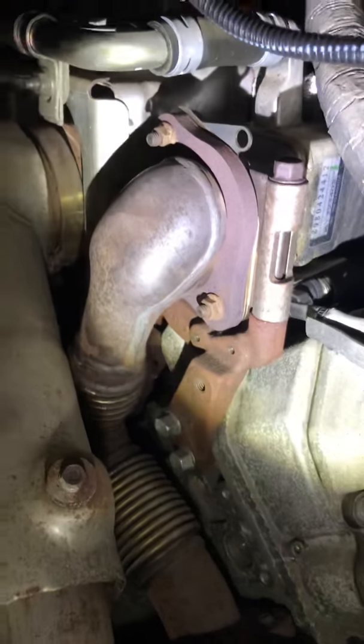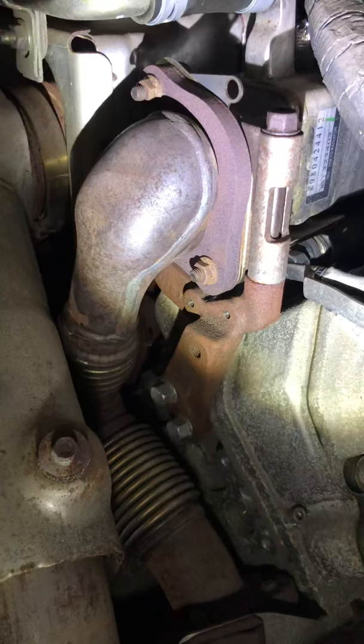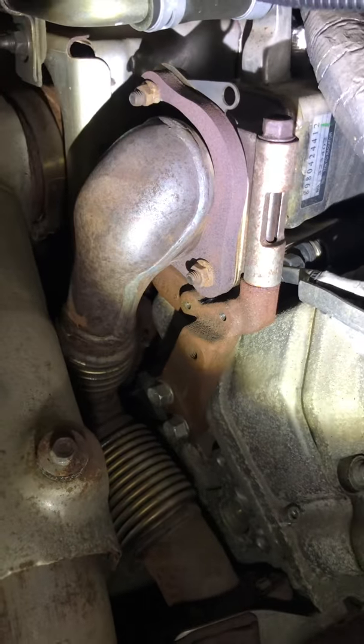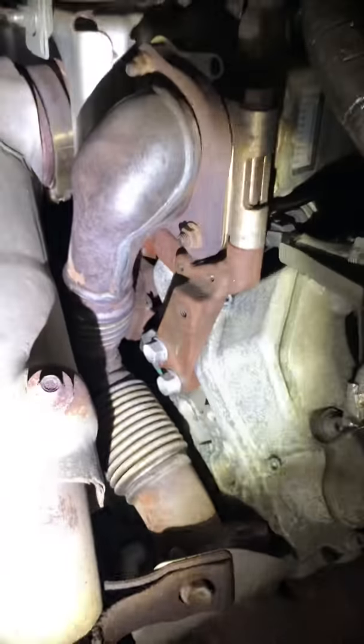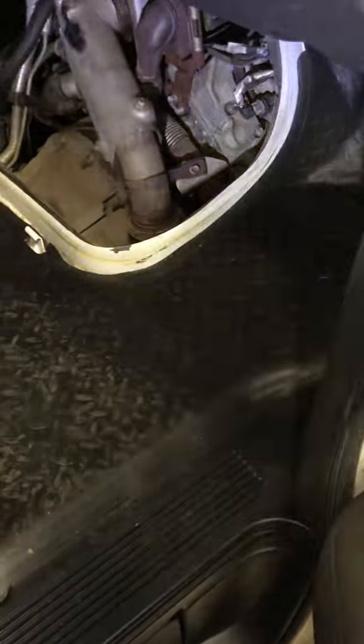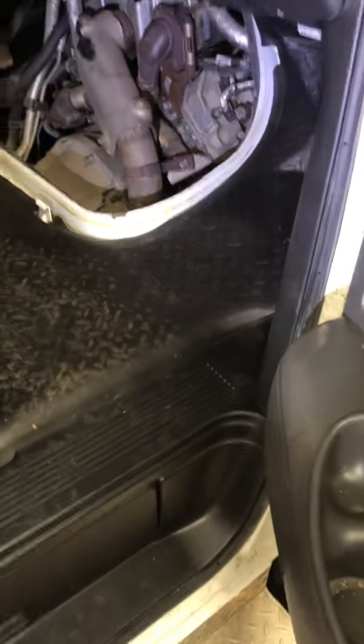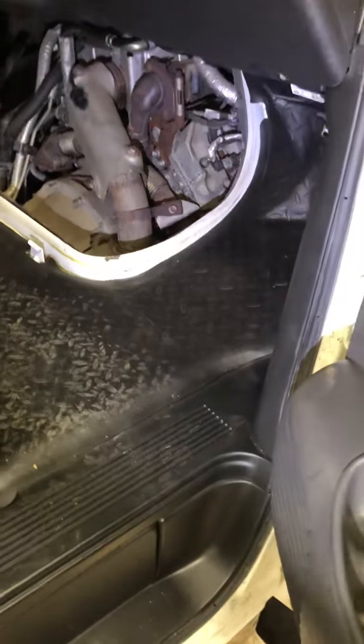The other one is a lot of fun to get at — your EGR switch. That is right there, disconnected from the housing. I'll try and get a view of it from the back side. There's a trick to getting this unplugged. What I did was I took two pry bars, different lengths, and held one prying in on the switch.